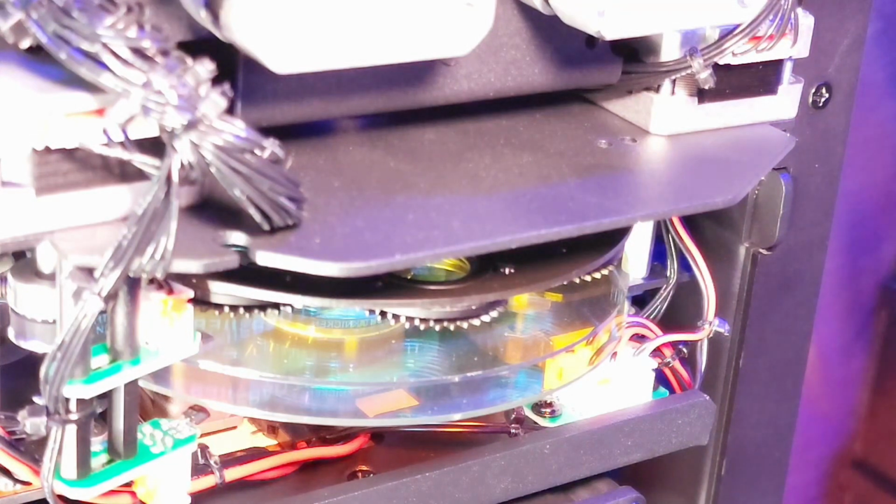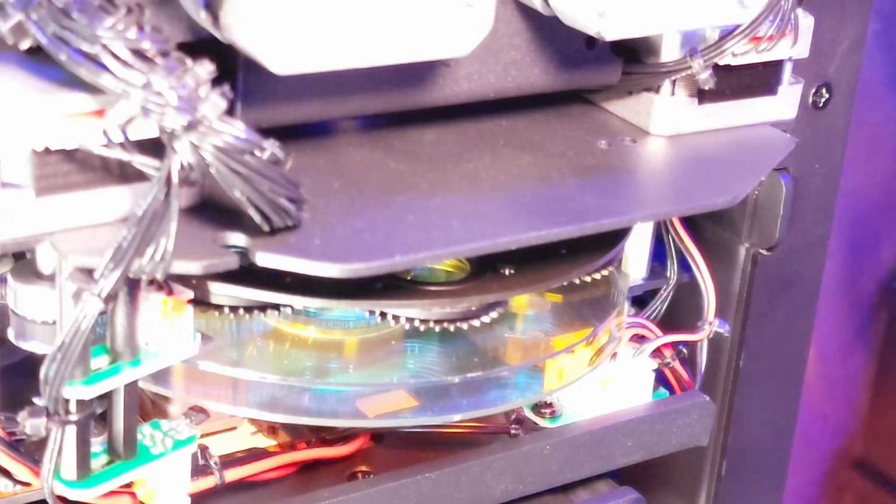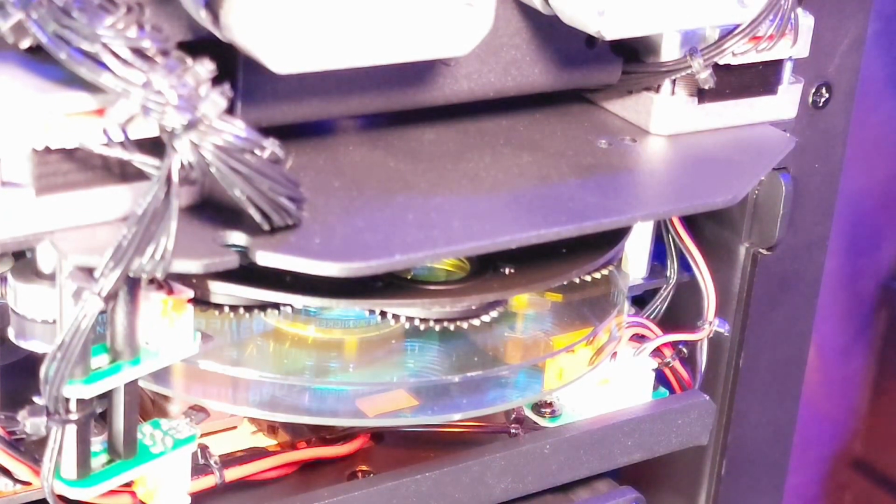Thank you guys for watching this quick video on how to replace a glass gobo. In this case, it's for a VShow S712 Kuon, a 450 watt LED beam spot wash CMY system. A lot of these new moving head fixtures have the same slot and lock system, so odds are if you have purchased a newer moving head fixture with glass rotating gobos, they're also going to have a slot and lock system, so this video will also work for you.